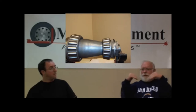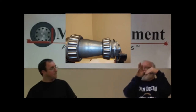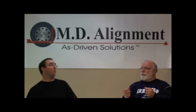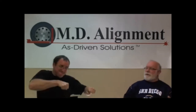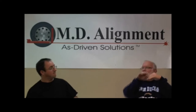We have two tapered opposed bearings in that assembly. When you jack the wheel up off the ground, the hub will slide in the valley between those two bearings. And it will feel tight depending on how you wiggle on it. Some guys will take a bar and shove it in through the handhole of the tire and try to pry on it to see if it's loose. But what they're doing is they're only moving the hub on one aspect of the bearing. We find we have to wiggle it back and forth in order to get it loose.